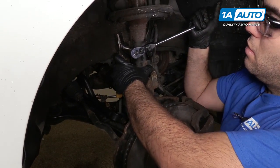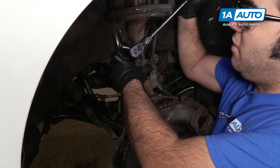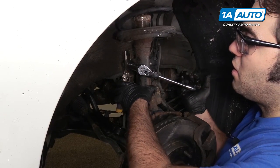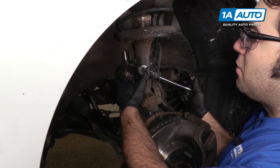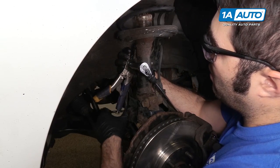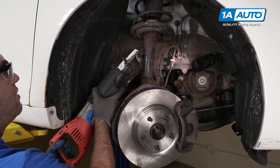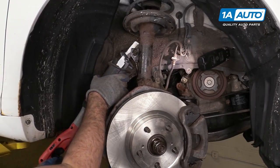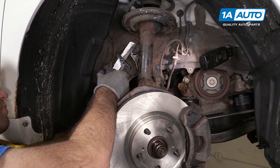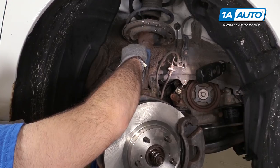I'm going to try to move these — it feels like it's turning. One thing to mention: if you're going to have to remove sway bar links for any reason, you should have new ones on hand. They're almost a one-time use part. And if you're as lucky as us, you'll have to resort to power tools or a hacksaw to cut these sway bar links free. I'm going to do my best to avoid the strut — I want to find the narrowest part of the ball joint in the sway bar link.